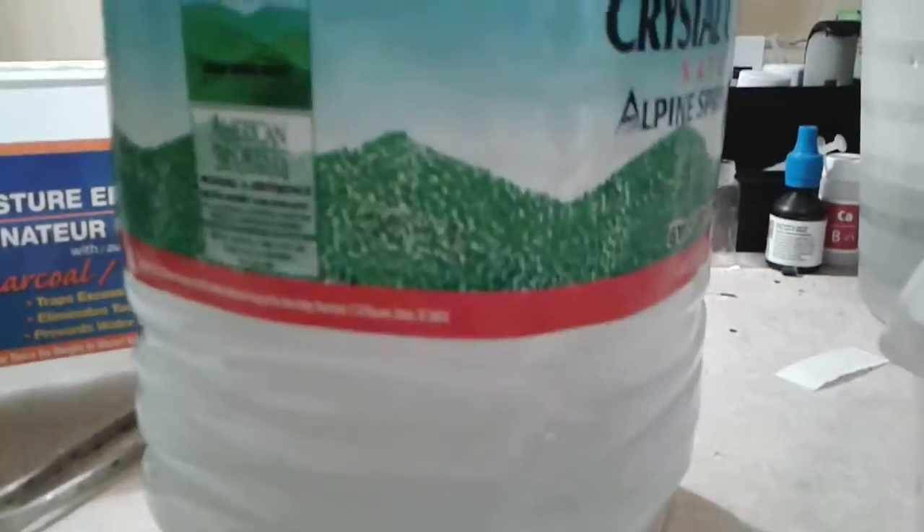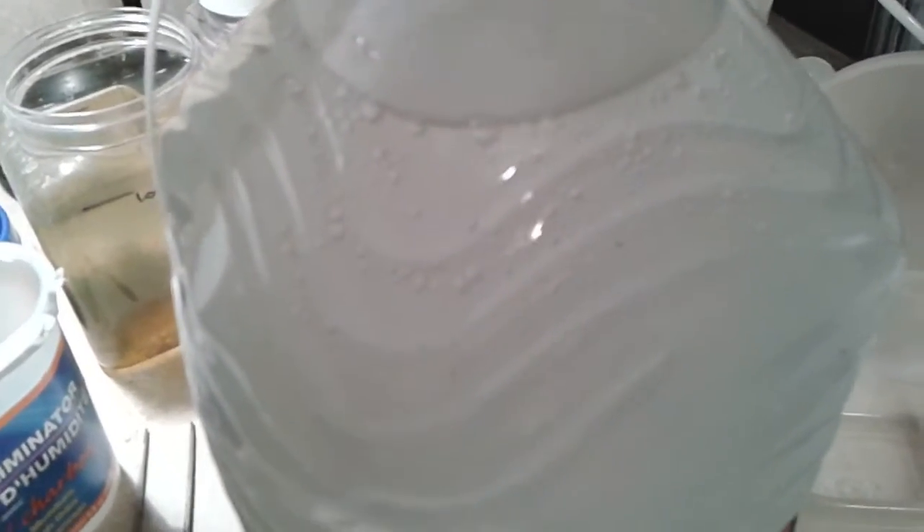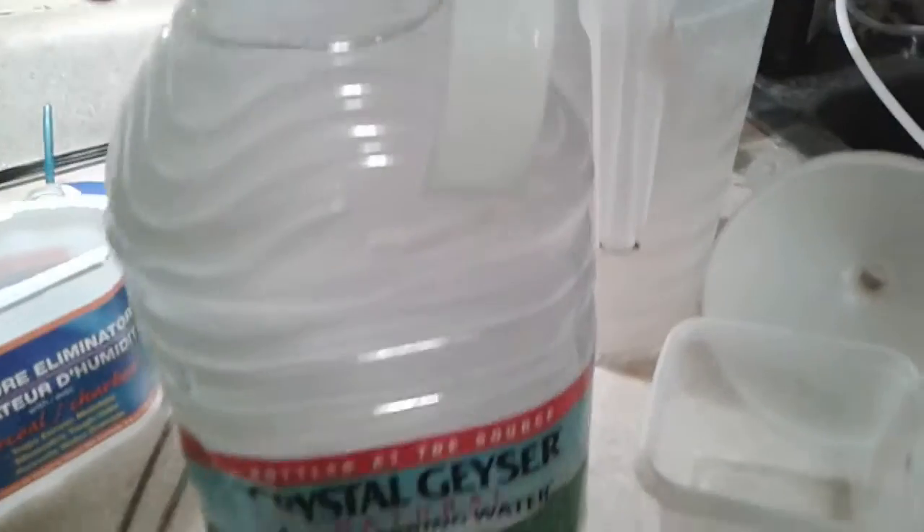Got them poured in. You can see it's fizzing a little bit — these will mix a little hot. So shake it really good, release a little bit of air off of it, and then add the rest of the water. Shook it up really good. You can see the little bubbles from it mixing, and it'll get a little warm to the touch — that's just the chemical reaction of the calcium chloride breaking down. Nothing to be alarmed about. It completely dissolves clear — it'll be cloudy for a little bit from the bubbles, then it'll be clear.